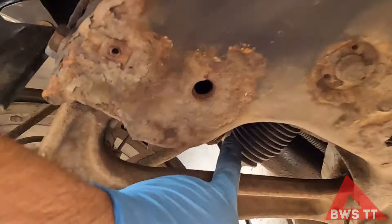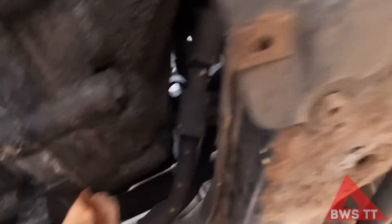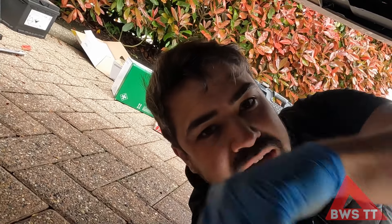I don't know why it scares people. You've got four big bolts for the subframe, drop links, ball joints, dog bone, and there's a little mount. The P-clip for the power steering line goes onto the anti-roll bar bracket — that's awkward to get to, and that's probably the worst bit of the job. So it's not that bad a job. I don't get why people whinge about it. People will do all sorts of things, especially when they're changing the downpipe, just to avoid taking the subframe off. Just make it easy for yourself — take the subframe off.